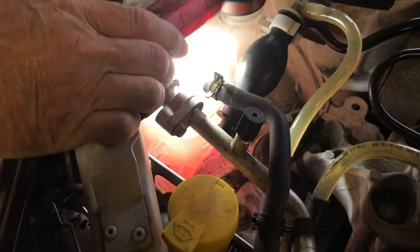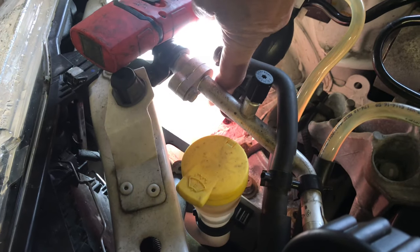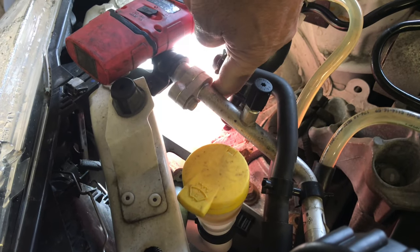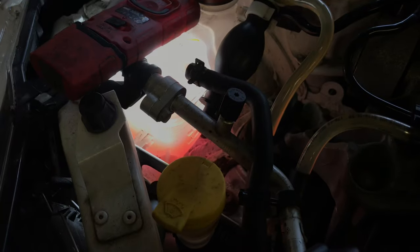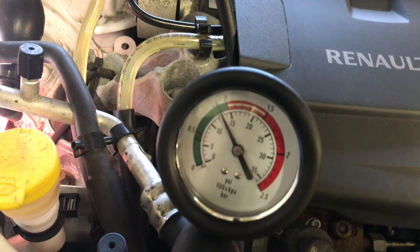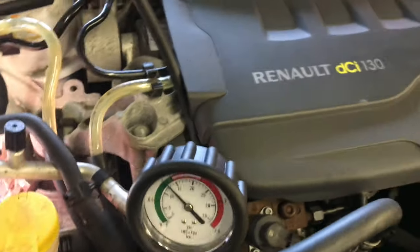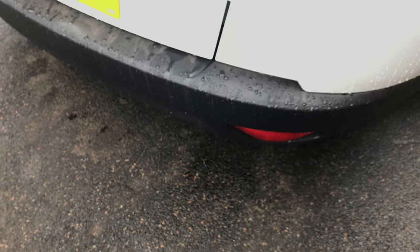There's the proof — you can see that the coolant is falling. It's going down and our gauge is falling as well. I think we've seen the exhaust was a wee bit of heavy smoke. I think we've got a coolant leak — head gasket job I think.